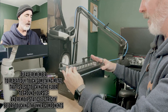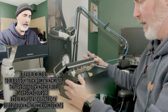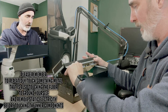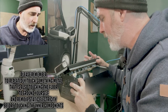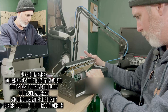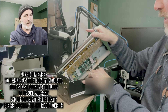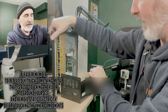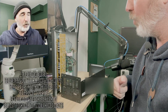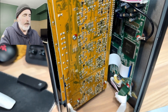What I've done is I've got it laid on its back, taken out all the screws, and what I'm going to do is slowly tip the cover forward. As soon as you do that, you're going to see the ribbon cable I'm talking about that stops you from opening it. It's this main ribbon cable here — it could be power; it looks like a power connector for the main board. Once you've got it tipped forward, you can actually tip it up on its side without stretching those ribbon cables too far.